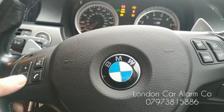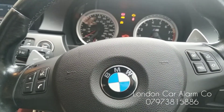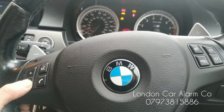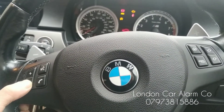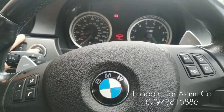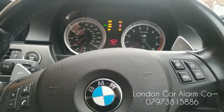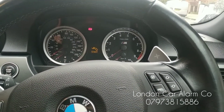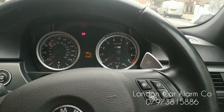So we do that now: main ignition on, disarm the system, receive your melody — there you go. Then hit this 11 times: one, two, three, four, five, six, seven, eight, nine, ten, eleven. Cycle the key off, pause, turn it back on — two bleeps, that's now in valet mode. If I leave it about 10 seconds, I'll just be able to start the vehicle straight off. Really straightforward.